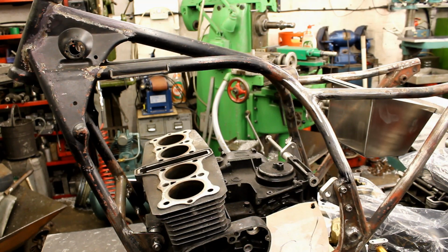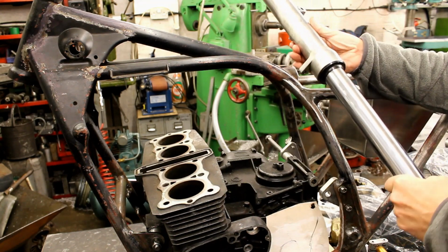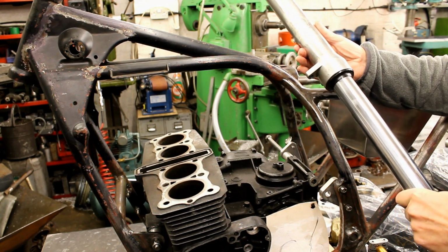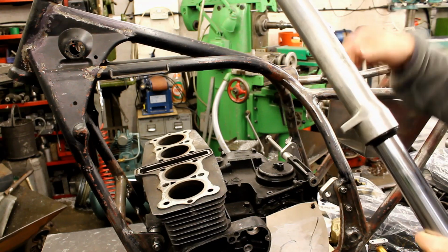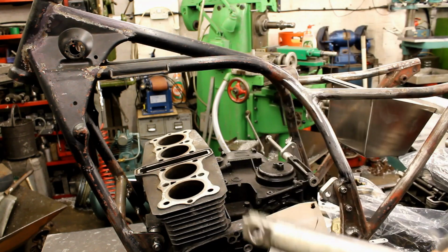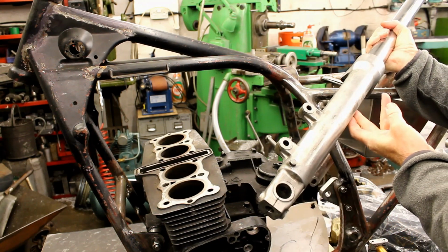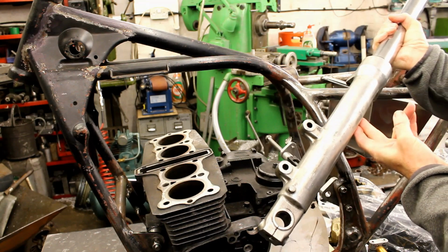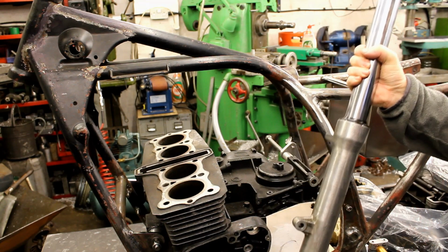Yes, these mysterious forks that didn't seem to fit anything out there. You thought it might be a Suzuki or perhaps a Yamaha. Possibly, and we thought at first it was a Gixxer. No, it's not. It might be an RF 900, but no, because they look the same, but it has a different size axle. So after lots and lots of checking and double checking, turns out these are from a Suzuki GSX 1100F power screen. And I've checked everything, and that's what they're from.